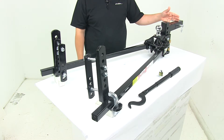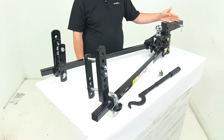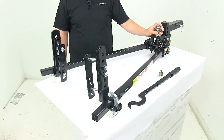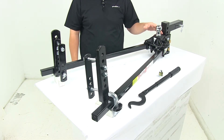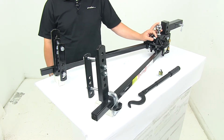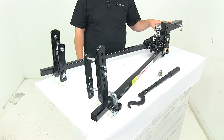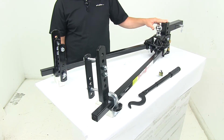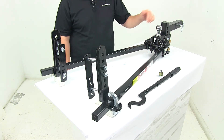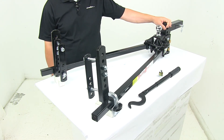The shank length from the center of the hitch pinhole to the center of the adjustment holes is about 8 inches. From the center of the hitch pinhole to the center of the hitch ball is about 12 inches. The total height adjustment along the shank is 7.5 inches. In the rise position with the head assembly at the highest setting, it gives you a maximum rise of around 7 inches, measured from the inside top edge of the receiver tube to the top of the ball platform. In the drop position at the lowest setting, it gives you a maximum drop of around 3 inches. The holes on the unit are separated on center by an inch and a quarter, which is your incremental height adjustment.